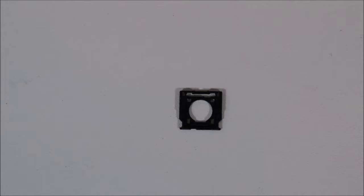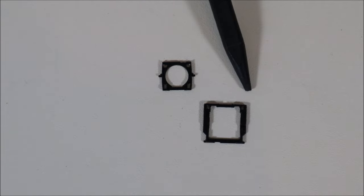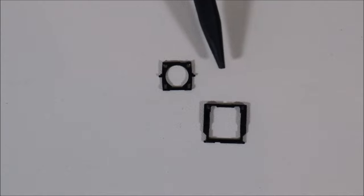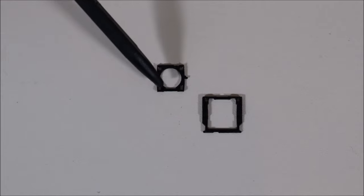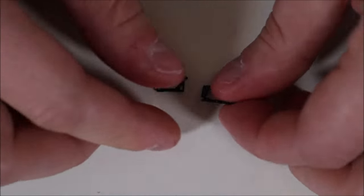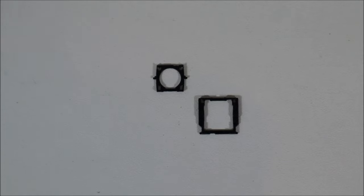The other thing is the hinge clip or retainer clip in between your key cap and the rubber spring — that's a two-part clip. If it comes apart in two, you didn't necessarily break your key; that can be put back together. This is the inner clip and there's the outer clip. On either side of the inner clip you have plastic pins that go into corresponding plastic holes on either side. You may have to hold one end and gently pull out the other end to make room, but you can put them back together — very breakable components, but reassemblable.